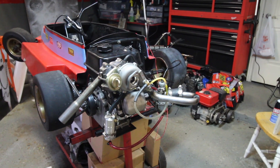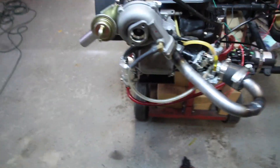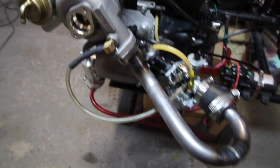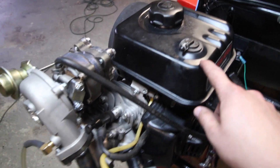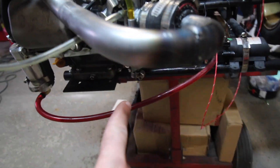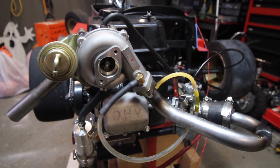Let me go through what you'd need to do if you're trying to pressurize your carburetor in a hopefully pretty safe way. Basically there's a hole in the front of the Mikuni where if you don't plug it, the air just gets forced in there and blows everything up out of the bowl — which is horrible. This upper vent for the carb bowl we ran to boost, and that's our way of pressurizing the fuel system without pressurizing the gas tank directly. We had to plug the drain bowl because even with the screw fully torqued down it was still pushing out air, which confirms we're definitely making boost pressure. We also put a zip tie around here as a precaution because it seems like an easy place to leak. This whole setup is pretty gnarly and it just looks so good with the turbo.